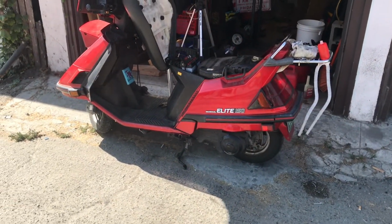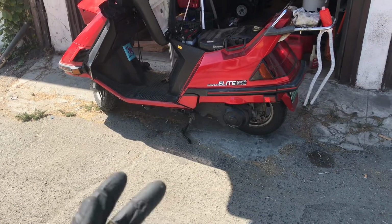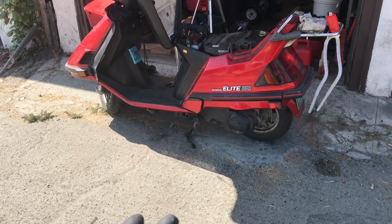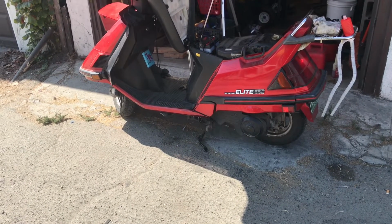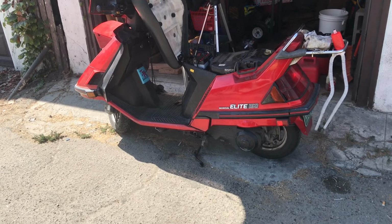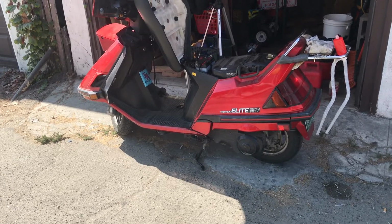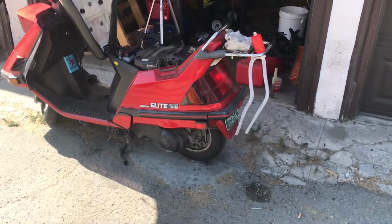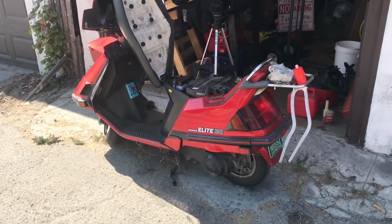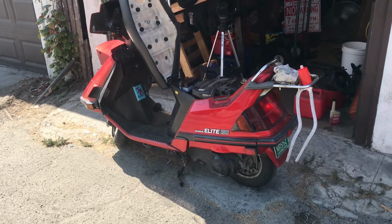I've done this when I lived in New England with snowmobiles and jet skis. And next summer or winter, I'm fine. They start right up. The jet ski was definitely easier. Maybe I took the bowls off the carburetors just to check, but they're pretty much spotless. Maybe the next season after that, clean out a carb, but that stabilizer works great.